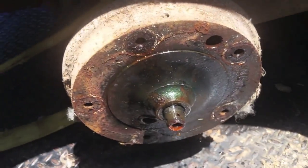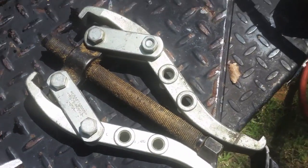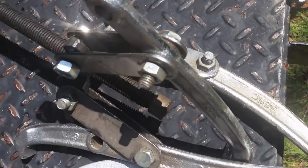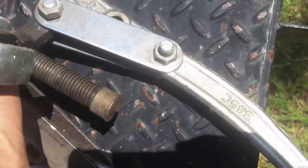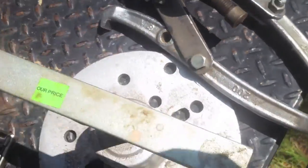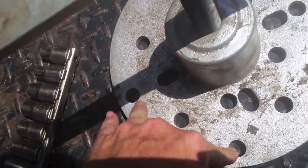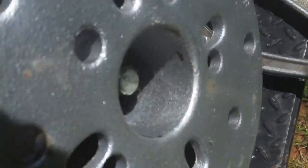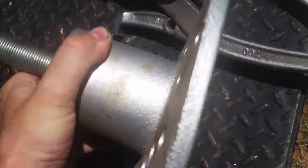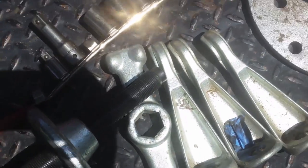She's stuck tight, so let's look at some pullers. You've got your Craftsman, Harbor Freight, whatever — two jaw, three jaw. They just blow up; if you've got nothing else you can try it, but you're probably gonna blow it up. I've used this interesting one I bought at a local tool store — it's got the wide five pattern among all the other ones. The only thing that sucks is you have to get long bolts because the hub's kind of small to go around Beetle stuff.